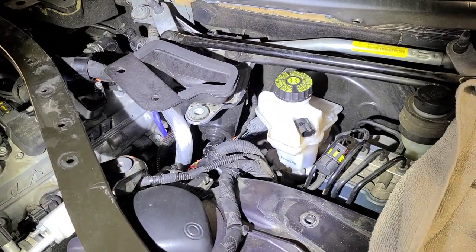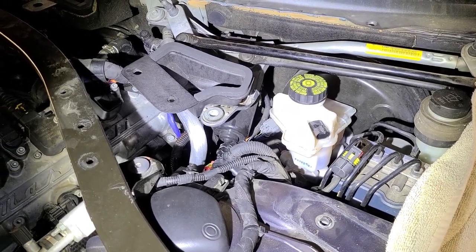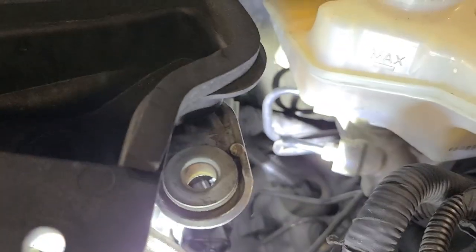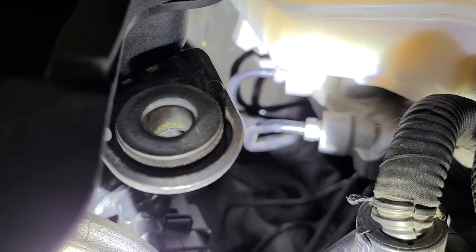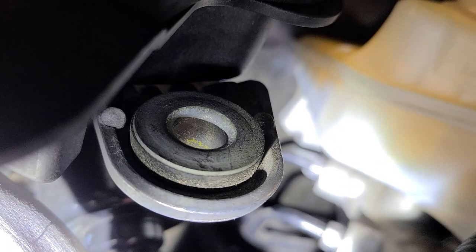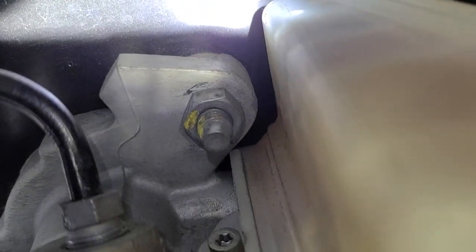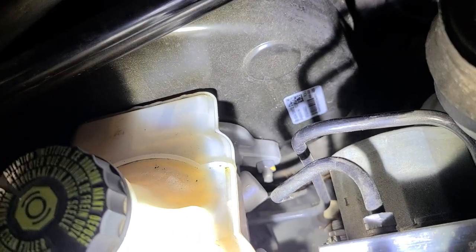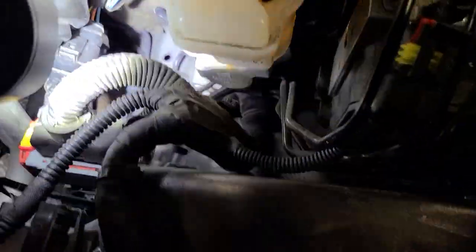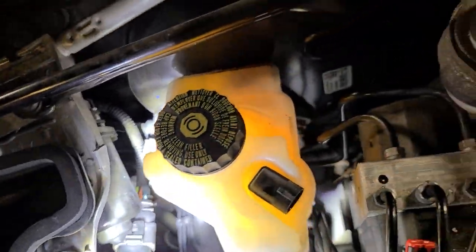You'll notice I'm switching back and forth from my Canon camera to my phone because I don't want to remove the Canon from the stand. Here's where we're at inside the car — here's the master cylinder. With a flashlight you can see the two lines back in there. I have to remove those lines and the two nuts — there's one down in the back and another one. I've already disconnected the electrical line. Before I begin disconnecting the brake lines I'm going to put a thick rag down in here to catch the brake fluid that's going to spill. I'll leave the cap on and we'll see how it goes.